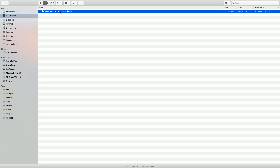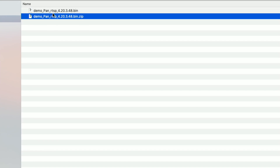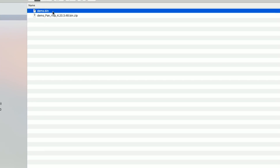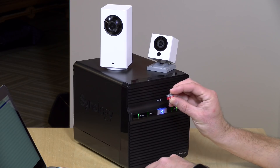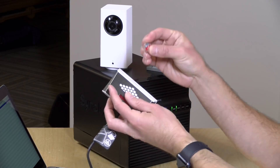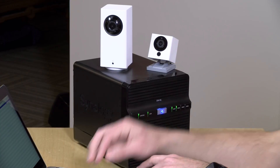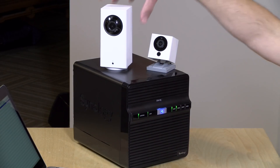What you want to do is extract that zip file. If you're on a Mac, you can double-click on it. On Windows, right-click and select Extract All. You'll be left with a new file called something like Demo Pan RTSP dot bin, and what they want you to do is rename it to just Demo.bin. Then get out a micro SD card — this file is only about 11 megabytes, but you might want to use the card to record on later, so I've got a 16 gigabyte card. Insert it into a card reader and drag that Demo.bin file over to the SD card. It will copy over very quickly because it is a very small file. When that's done, eject the SD card.